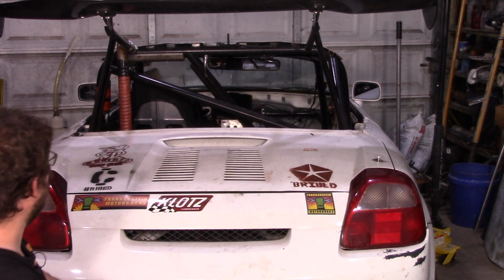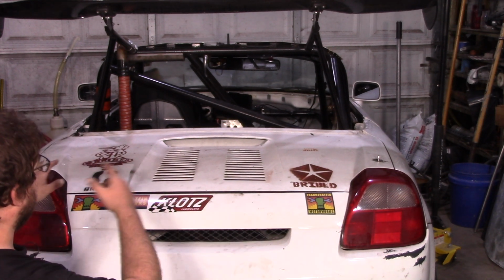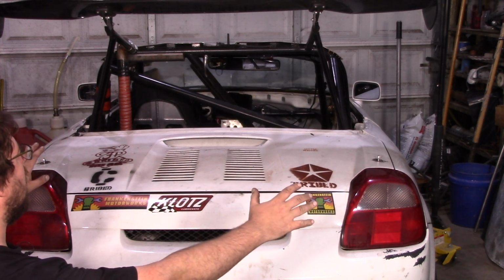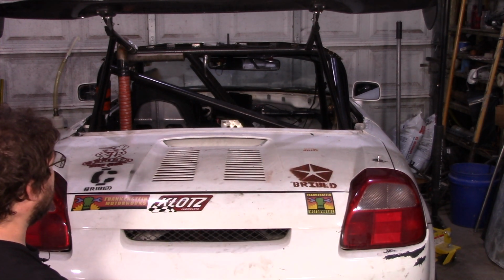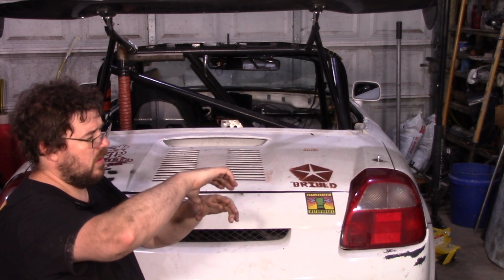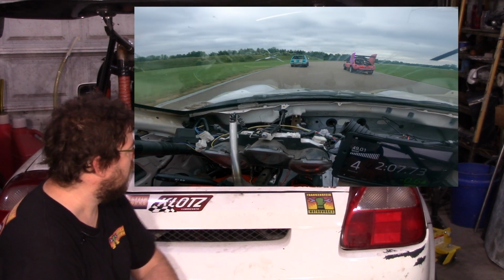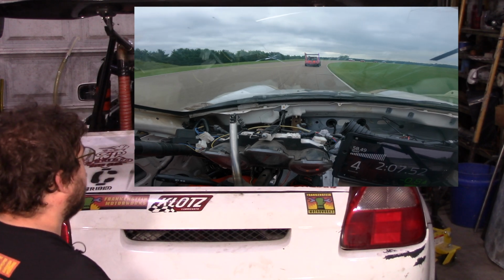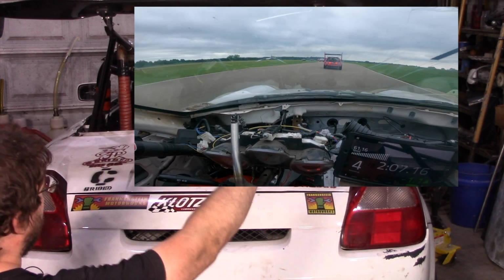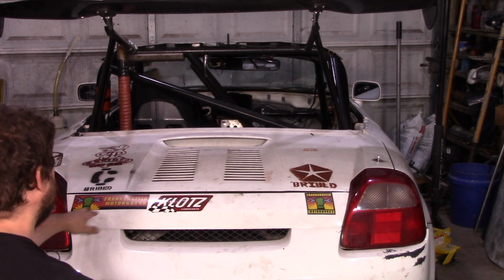Well, if I think about how the car goes around the track, road courses are clockwise, so you've got a lot more right turns. Particularly Gingerman Raceway, which is the last track we went at, has, I think it's corner 8, a really long carousel. You can see it right here. You're just sitting there hanging at like 0.8 Gs for several seconds, and what I think is happening is that's making the car shift over, and the 5-degree angle is being lost on this side, so the body's dipping.